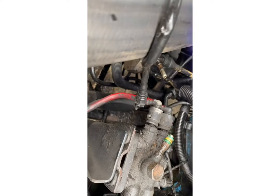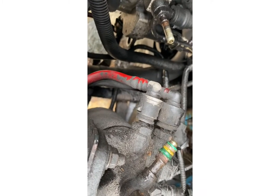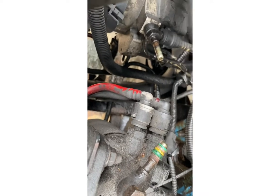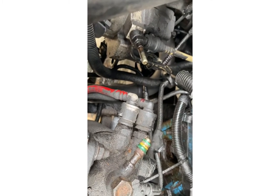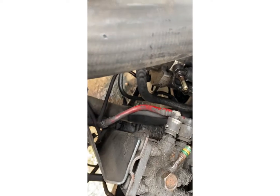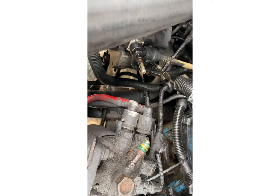Well, we've got them off — not entirely how I planned it. I was about to break the end of the connector; as you can see it's all crusty, just wasn't moving, wasn't pushing in, wasn't sliding back. So I'm thinking, until I can get one of these connectors ordered up, a length of fuel line with two jubilees on should do the trick. We'll go and pick them up, get that fitted, get one ordered, and then make the actual pipe using the two ends — a temporary repair to keep me on the road.